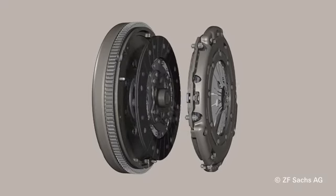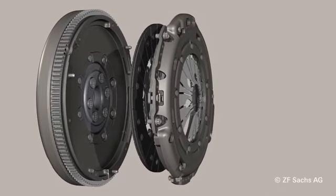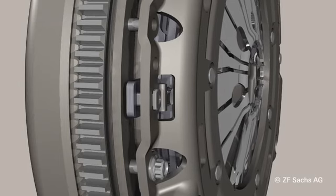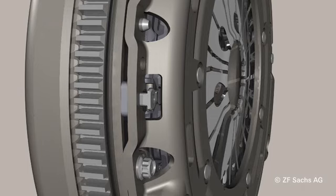The Extend pressure plate and the clutch disc form an entity because the lining wear remains on the pressure plate mechanically. Therefore, reassembly is only possible with a fixed pair that was taken out together, the disc and the pressure plate. If a new clutch disc is necessary, the entire clutch set must be replaced, for example, the pressure plate and the clutch disc. For assembly, all screws must be tightened crosswise diagonally, constantly in at least 4 steps. The readjustment system is now active.